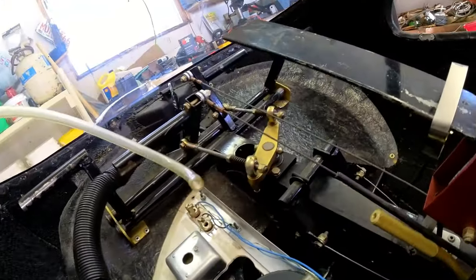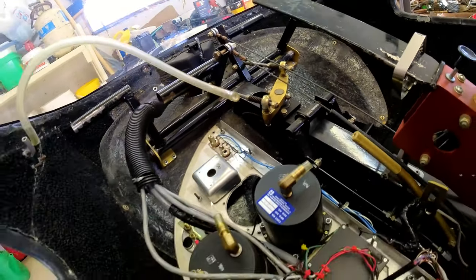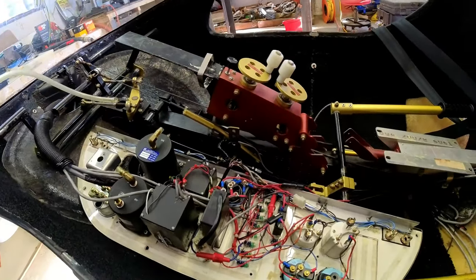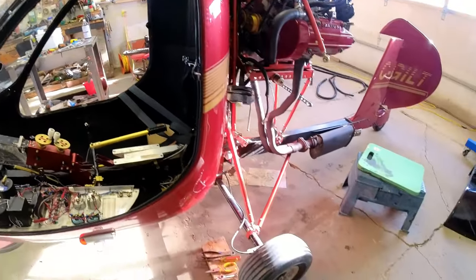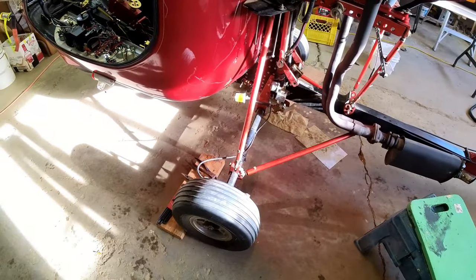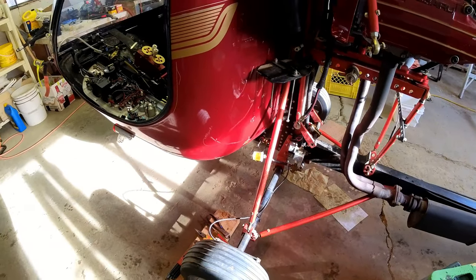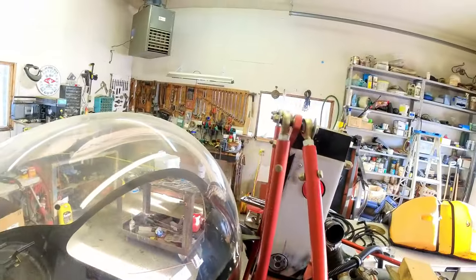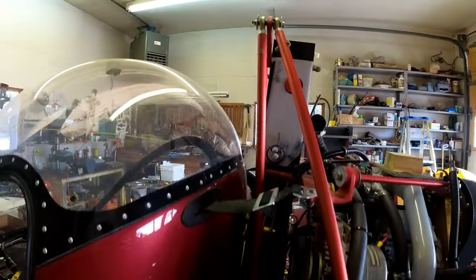While it's apart, lubricate all the joints, the rod end bearings, the cables for the rudder and for the brake. We'll have to jack it up and do each of the wheel bearings — make sure they're greased. Replace the fuel lines and replace these rod ends, plus two more up here and a couple at the bottom.